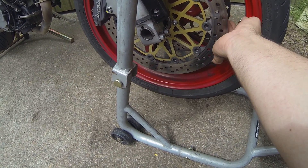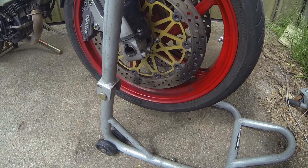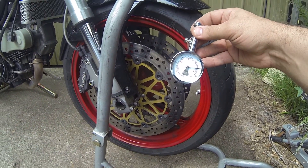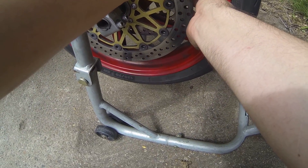And this winter air can give you dangerous tyre pressure spikes. So now we're into this warm summer day, with much denser winter air in the tyre. You can have a look at the tyre pressure and see what happens. For commuting I run about 36 psi, and here we can see it's nearly 50 — so that's the sort of danger to yourself and other road users.